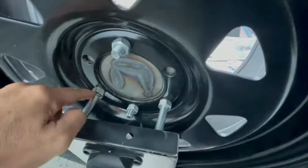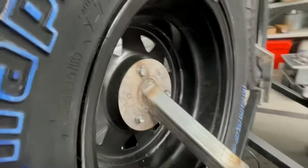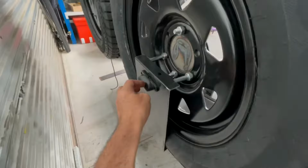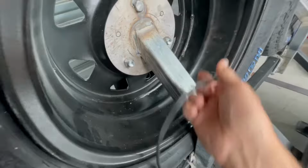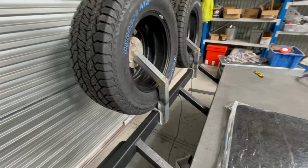There's a wheel nut on this side at the full length of the thread, just pulled into the hole there on the wheel. And then at the back, I just pick it up with a couple of nuts that I'll tighten up and it should be good. And then the light lead comes through the back here. I'll just have a quick connect plug that goes through the wheel and down to here. And that can then be flexible and move around. This wheel mount's portable and it can move over to the center if I'm only carrying one tire or whatever. I think it should work, hopefully.